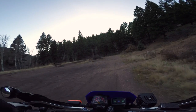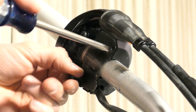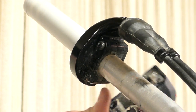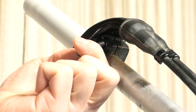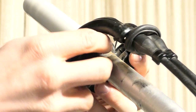Moving over to the right side, I'll use a 10mm wrench to remove the clamp for the front brake lever and master cylinder assembly. I'll just lay this to the side being careful not to hit the tank. Be aware if you lay it upside down like I did, it could introduce air into the system and should be bled after you're all done. If your TW is pre-2001, you will not have a hydraulic front brake and this will look different.